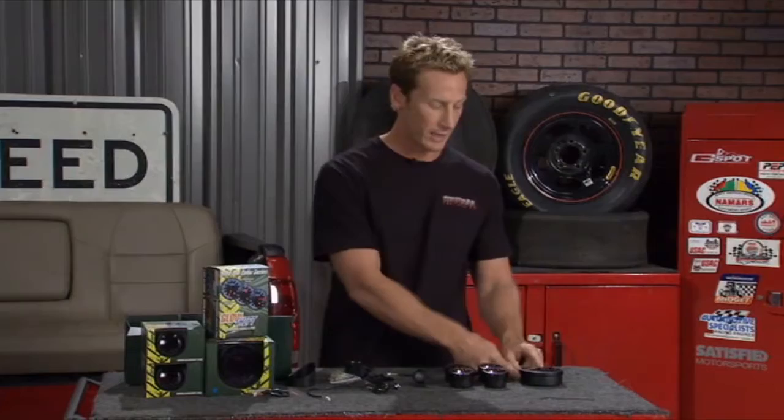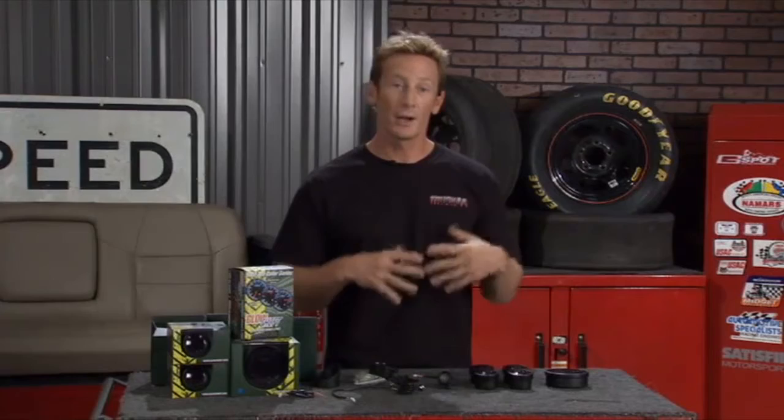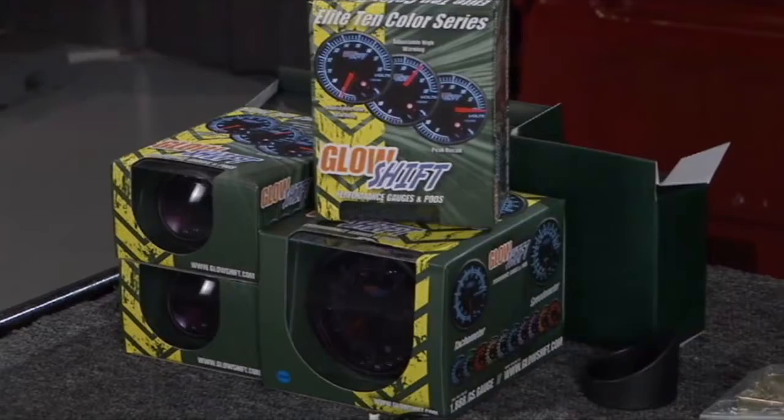What we need is a high-end tach to keep us in the proper RPM band, which is really critical in a race vehicle. We're also going to use a shift light that'll pop off at the right RPM so you hit the right gear at the right time. We're monitoring two water temperature locations, oil temperature, and oil pressure. When laying out a custom dash for a race vehicle, it's really all about personal preference. My preference is to have the tach as close to center over the steering wheel as possible so it's right in your line of sight — your driver isn't hunting for it going down the track. The rest of the gauges get clustered as close to the tach as possible. Now we need to cut out a cardboard template to get our custom dash going.